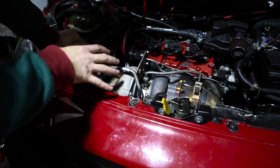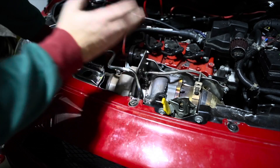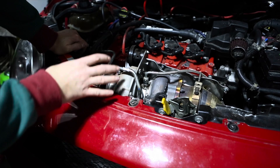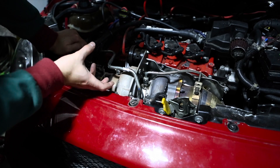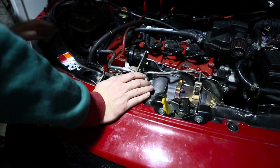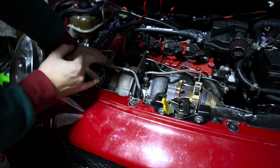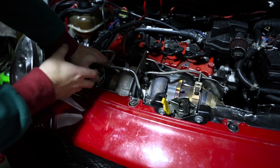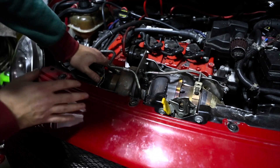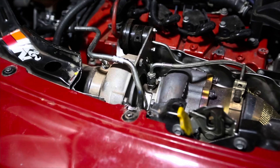As far as the turbo goes, everything went in decently smooth. There's slight stuff that this heat shield for the manifold might cut down the road, but for right now I kind of want to keep that heat shielded from the head of the engine. The intake is a 3-inch inlet compared to the factory's about 2-inch and some change, and this runs down to the fender well. There are small adjustments that had to be made — it has a T-bolt band clamp on it because it was pushing off every other clamp that I put on. So I put something a little tighter and snugger fit on there. I'll go ahead and zoom in and show you guys.